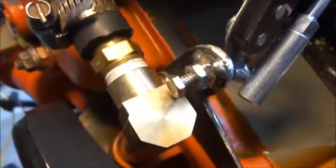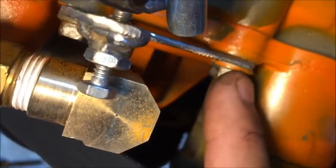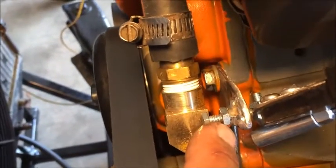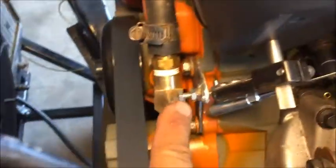I also made this plate — I just cut it out of a piece of metal. This side is notched so I can slide it over the bolt, because this bolt can't come all the way out without taking off the tensioner. This plate has a nut welded onto it, and here's my stop nut — this is my adjustment. Once I get it to a certain position on the computer so the idle air control motor can work, you lock that down and tell the computer where your new idle position is, so it knows your TPS is at zero.